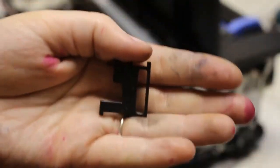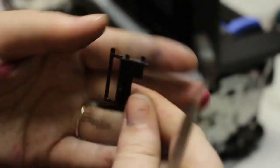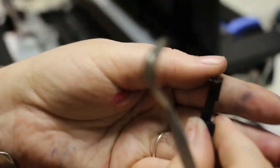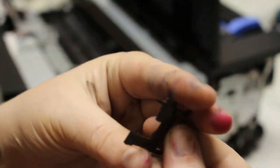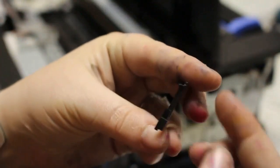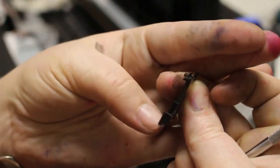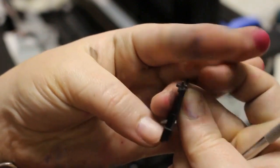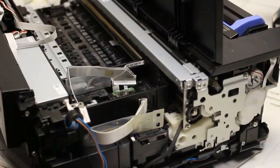Here I have it up close in my hand. It looks almost like a belt buckle, and you can use a little toothpick or dentist pick to pull up on that buckle part and then pull it to the side — there are tabs that lock into place. When you lift up on that buckle part and push to the side, it should release and snap off of the carriage, and that will release the FFC cables that the buckle holds onto.